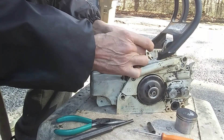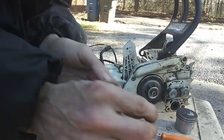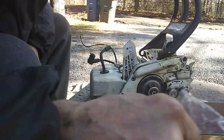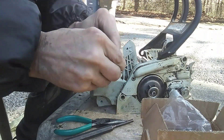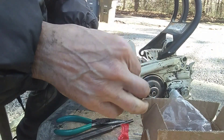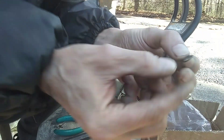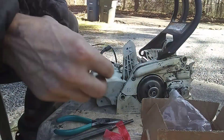There should be a needle bearing in here. Not in bad shape, but we've got a new one in the kit. Now, there's one thing about the wrist pin clips that come in here — they've got a center piece inside them. So when we get ready to put it back on, there is a little middle piece right there that you can hold to get it in there.